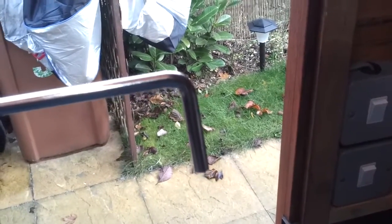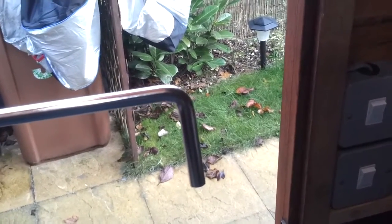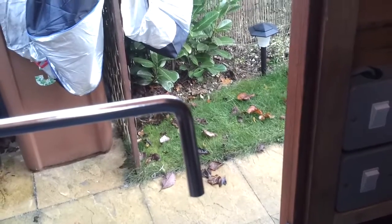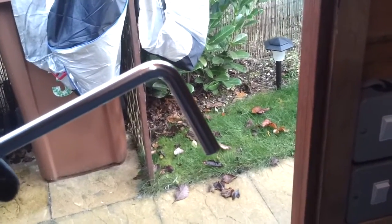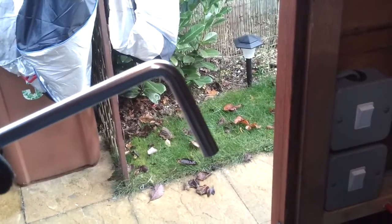Now on the front of the bike, it's like that. The lower supports are like that. Now the screen is virtually vertical. Now it needs to have a bit of rake on it, the screen, so the wind just doesn't hit it and you're just not driving against it like you got your brakes on.